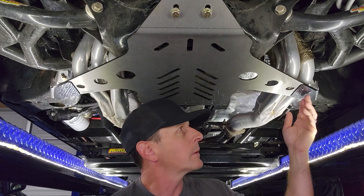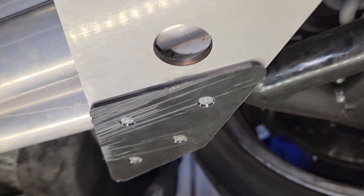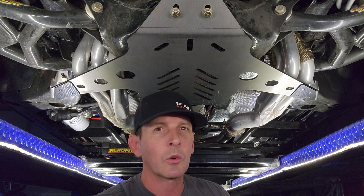It's not over yet. I decided to go on a little road test to test two things with these plates: obviously impact resistance. I found a dip in a driveway accidentally — nailed it — and scored this side of the plate. You can see up close some pretty deep grooves, but the plate is still here. It didn't come off, didn't shatter, and we still have plenty more wear left before I have to change those bolts or the plates. That's a much harder impact than just creeping over a speed bump. The second thing I wanted to test is temperature resistance. Delrin has the best temperature spec of the materials available on Send Cut Send. Granted, you can go high-end with PEEK or whatever, but the price goes up and availability goes down. These worked out great.